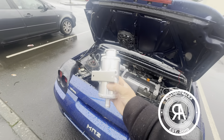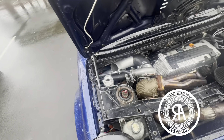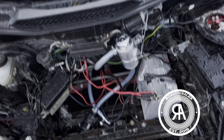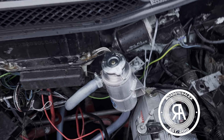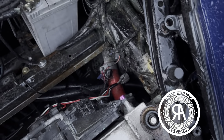I've got the tank here and I'm looking into where I can put this. I think if I put it right there, it could work. A few days later, I ended up pretty much using the same setup. Warm water coming from the back goes in there, feeding basically the bottom of the heat exchanger. I drove around for a bit, and now I'm going to connect my ECU to see what the intake temp is.